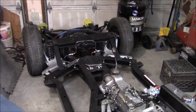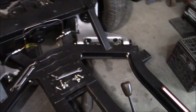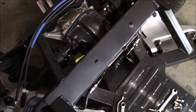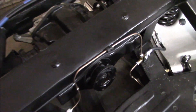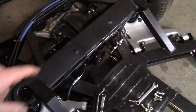The next thing we're going to do is relocate the car so I can get to the rear end a little bit easier, and work on detaching the sliding axles back here. I've only got it bolted up with two bolts per side, since I thought about removing this differential earlier and didn't bolt it up fully. I can actually see a pretty good pinion seal leak going on — the seals needed to be changed in this diff, and it's actually leaking quite substantially out of the pinion seal just from having gear oil in it. So that's another good reason to change this diff out.